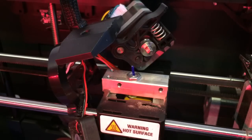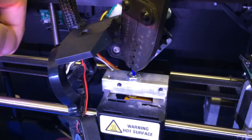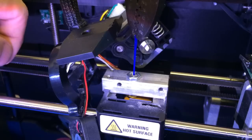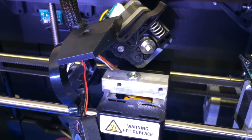So we're going to try pulling the filament out. It's 126 degrees — it might be hot enough. Now there's no fan on this, so this will get a bit hotter this time. But let's just try. Yeah, look at that — one broken bit of filament. That should now be quite happy to take a new feed of filament through it. So we're going to turn off the heater this time, pull down, and turn off the machine and put it back together.